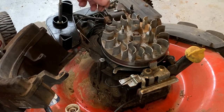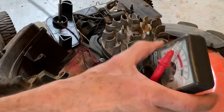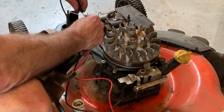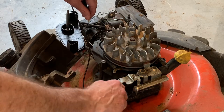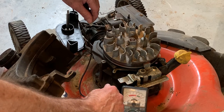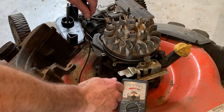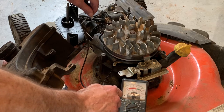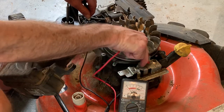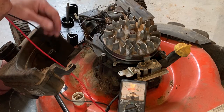We're going to test this wire right here — it comes out back through here and connects here. We're going to see if this is shorting out anywhere. I've got a quick tester here checking ohms. You can see the needle moves to zero ohms — this wire is not broken. It's connected to both sides, so if it's shorting out somewhere I should be able to touch either side and something grounded and see if it's open. The wire is not shorting out anywhere.